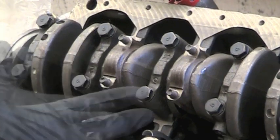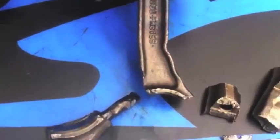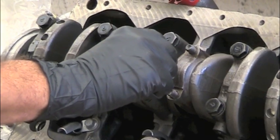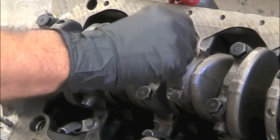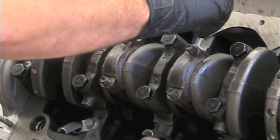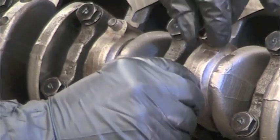This is something you may not see in your book anywhere. I personally had a bad experience with rod nuts coming loose and destroying a motor. I talked to Jerry Lemon about this and he told me he has seen that as well — the best thing to do to prevent that is to put a little bit of Loctite on those threads before you install your nuts, just to ensure that the nuts are not going to back themselves off while you're going down the road.